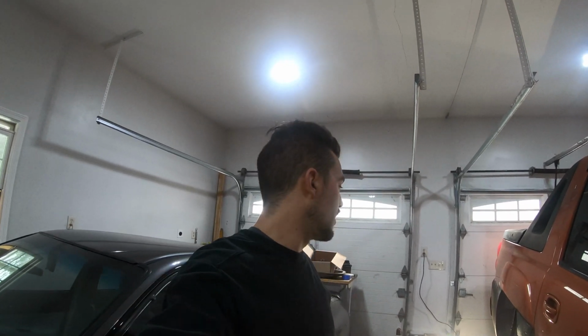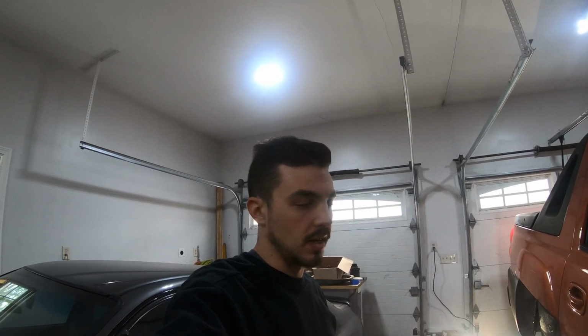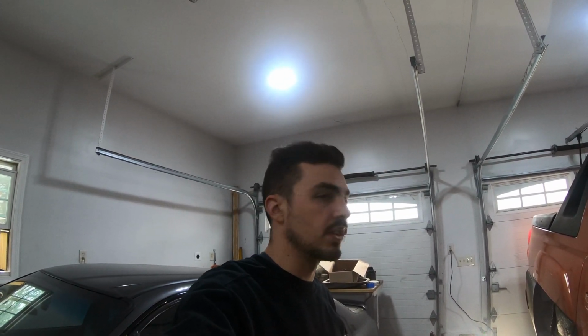So thank you all for watching, and stay tuned for part 2 where we see if I have a bent axle or possibly 4 bent axles, which I think is going to be the case. I think the 2-inch wheel spacers are just too much for these vehicles. The axles can't handle it. I don't know. We'll see. When there's back spacing on larger wheels, I think it's not as bad, but when you throw all the leverage point way out far with a spacer, I think it's just too much. So we're going to see what the run out is.